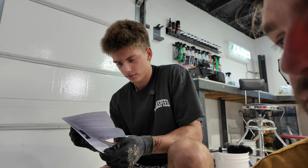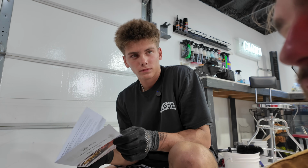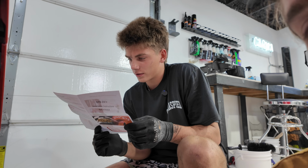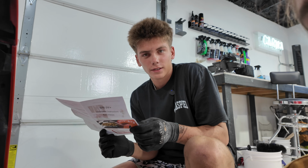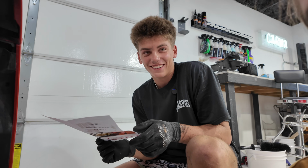What does that say? It's saying that when it's tight, it's gonna have the least amount of compressor surge, which is the most throttle response. Not cause compressor surge, turbo fluttering. By loosening it says? No, all the way tight. So you want that all the way out then.